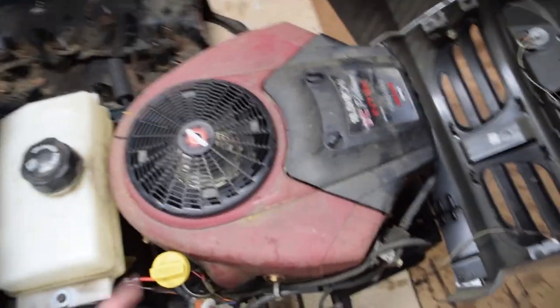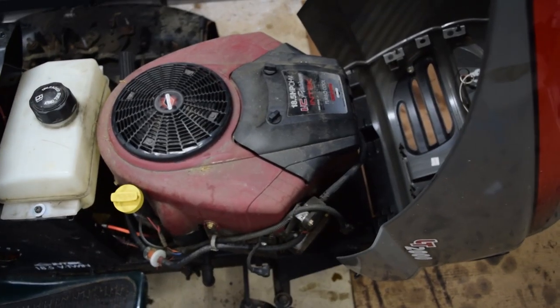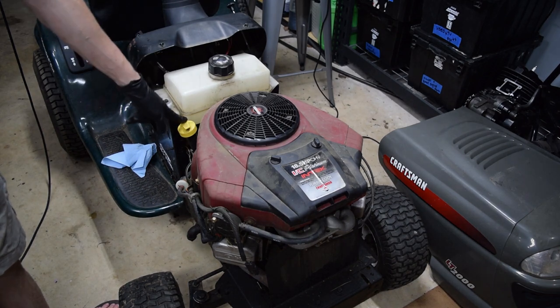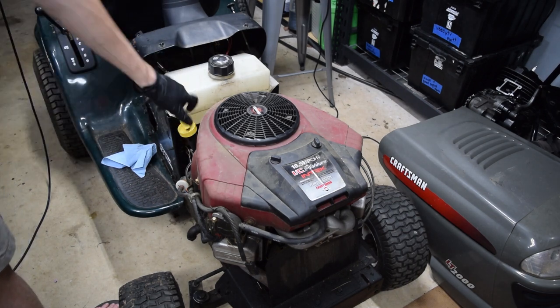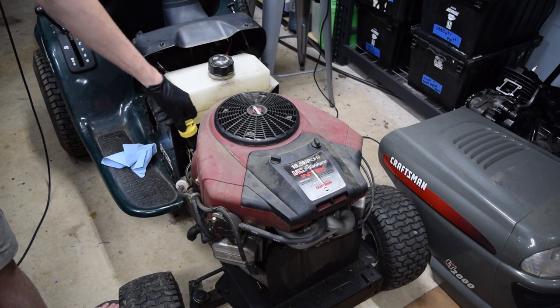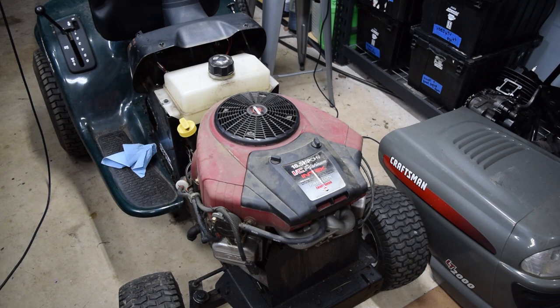It's got compression. The oil looks fine, the plugs look fine, the filter looks fine. So I'm really not sure what they're talking about when they say this thing would have blown up. I already went ahead and put oil in it, just because when I first got it I realized there was no oil in it at all. The filter's on it and the filter's used, so I don't know why it had no oil. I put fresh oil in with a bunch of Marvel Mystery Oil for that initial break-in, in case there's a reason why there was no oil.